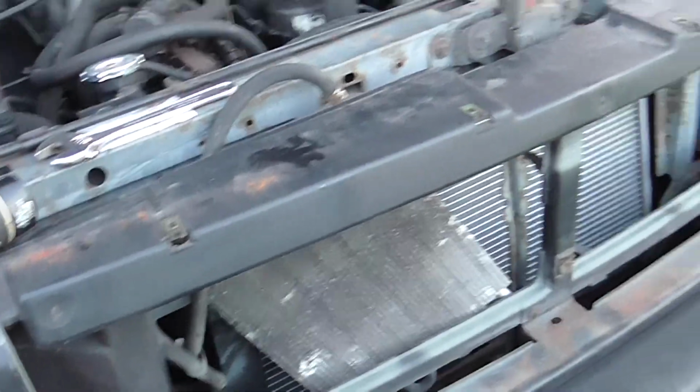And the key, I think, which you waited this long to know, is do you have to take the radiator out? At this point, I'm going to say no. No, you don't have to. You can just loosen it up and eke it out the front. So I'm going to just put it back and bring it back.